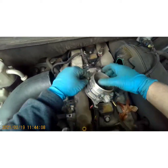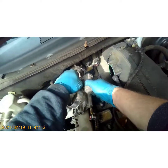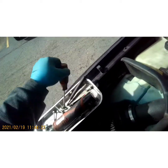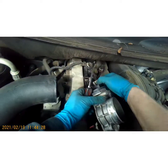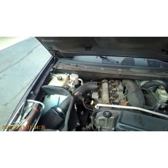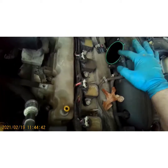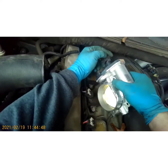Let's pop that off. Now we can get to the plug better. Let's get these bolts out before they fall. Now we can get this plug easier — take a little flat screwdriver on these locking tabs, pull on that, push in your tab. Now normally there's no core on those if you get a new one. This gasket still looks good — it's not flat, it sticks out — so we're gonna reuse that gasket because they don't give you a new one with the throttle body unless you ask for one.